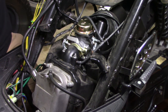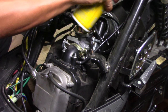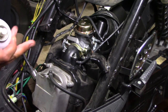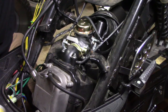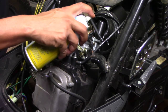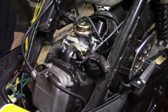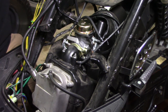I'm looking for any vacuum leaks, because it's getting leaner and leaner, meaning I have air coming in somewhere it shouldn't be. While the engine is idling, keep spraying these ends and connections. Once you get to a point where the engine accelerates and you can hear it, that's going to be where you have the leak coming from.